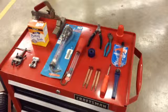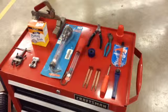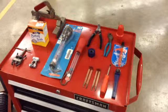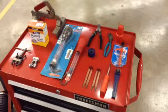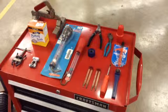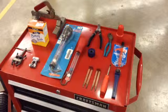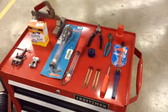Well, batteries, as we know, are typically 48-month or 60-month, one of the two. So a 4-year or a 5-year battery. And of course, in most late model vehicles, those batteries are typically lasting about 4 years. However, you're always going to get the guy out there who says, well, I've got 7 or 8 years on my battery and it's still going just fine. Okay, we're not going to argue with that. It does happen, but with more electronics being put in automobiles today, batteries certainly are lasting a lot shorter than what they were just 10 years ago.